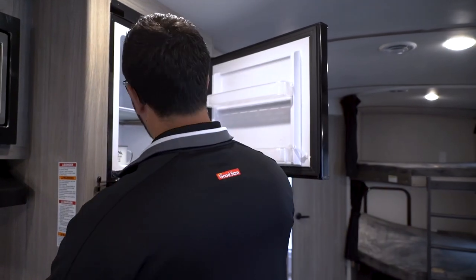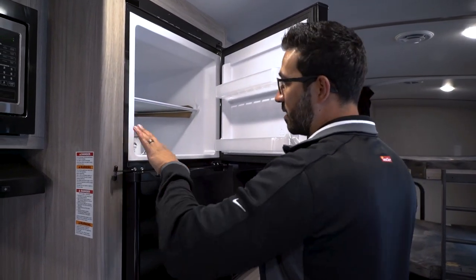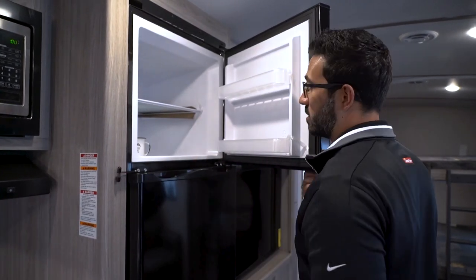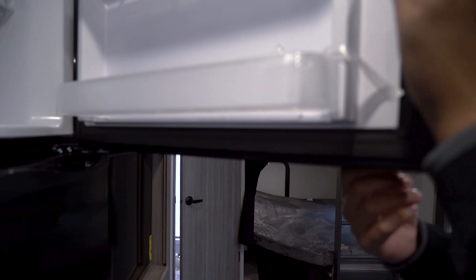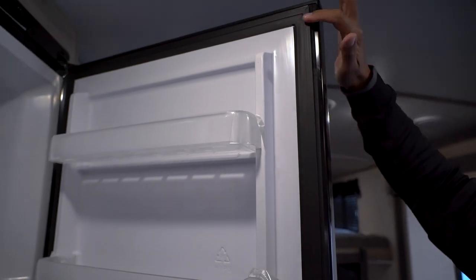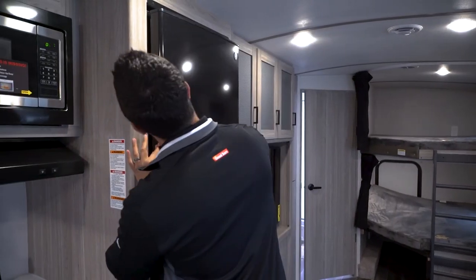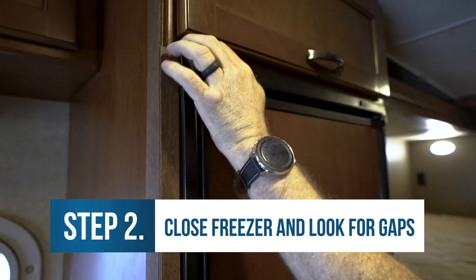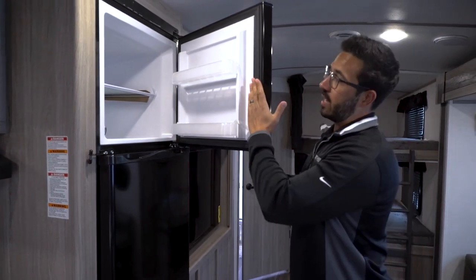So if you're not putting anything hot in there, you're not jam packing it, and you're checking that nothing is in the way of the seal — even something as thin as a grocery bag is enough to let warm air in — then it's time to examine the seal itself. Take a look all the way around and make sure there aren't any imperfections, chunks, or places where it may be slightly deformed. We want to make sure the seal looks good all the way around. Then when we close it, visually inspect to make sure it's evenly sealed with no gaps, because sometimes it may not secure quite right when closed.